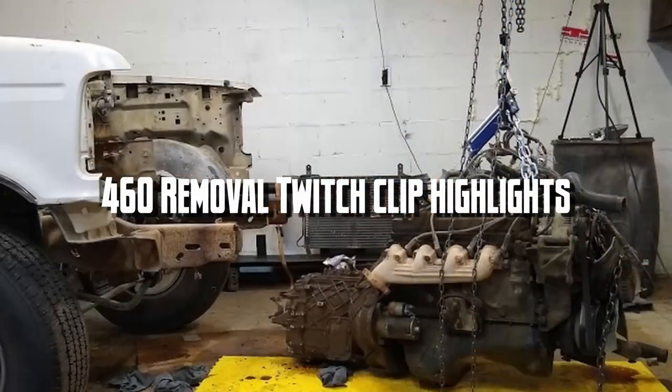All right, well, the corn husk over there has released the 460 from it. Myself and Powers got that out yesterday on stream, and it actually wasn't too bad. I think it took about 4 hours, all said and done. There was a little bit of hang up with the shifter and the firewall and stupid stuff like that, but that's how it always goes. Overall, it went really well. I'm super pleased with the ceiling hoist situation. The garage didn't fall down, so a successful test for an 1,100-pound drivetrain. I feel pretty confident using that in the future.